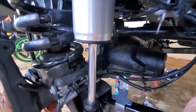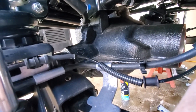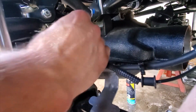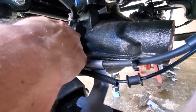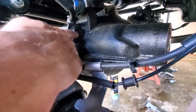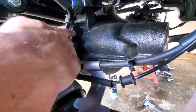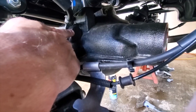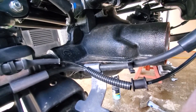While we're installing the ARB, Jeep gave us a great place to drill holes into the new Dana 44 Gen 3 axles — the Advantek. There's this casting mark right here where you would see the same place for a Rubicon locker on the Sport. It's the same Dana 44, just without the hole. So we're going to drill and tap a 7/16ths hole here.